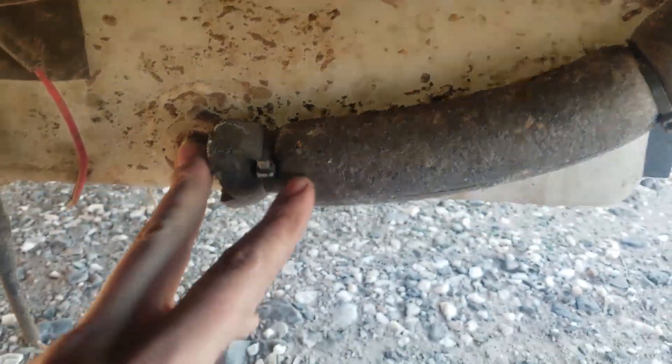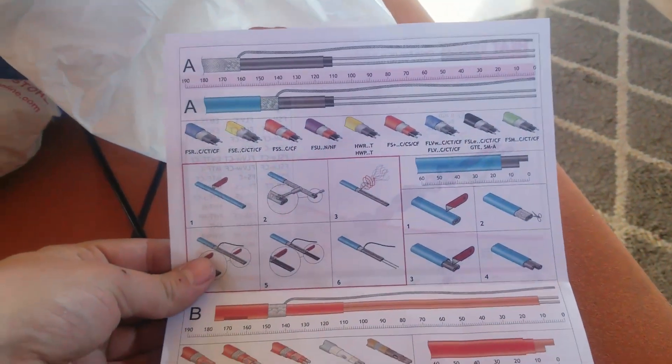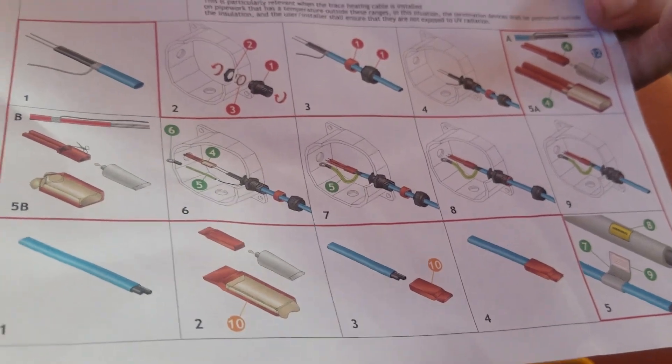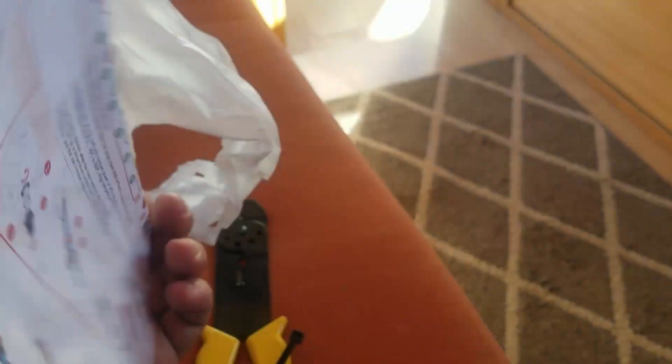This is a bit of a theme of the trip — get this 12-volt heat tape installed. Down under the bus, this is the water line that froze. We have the tank heater right here conveniently with oversized wires attached to the tank. The tank heater is this black thing up under here. I'm going to tap into this circuit and then run the heat tape from the bottom all the way up to where it goes into the bus. The instructions that come with it are just pictures and they're a little bit indecipherable, so I'm going to go through it carefully and do what looks about right.